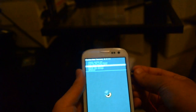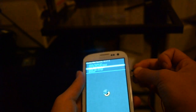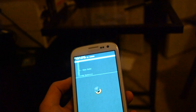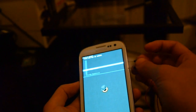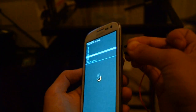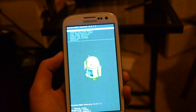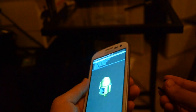So we are making our own power switch. You just keep on trying it until you get it — it'll take a bit. Move to an item you want to select, and move the wires around until they finally touch the two metal plates and make contact, registering as a power switch press. I got into this menu, selected wipe cache, and did the same thing again — put the two wires on the two sides of the power switch. Just keep moving it around until you get it. That's how you use the recovery menu — all you need is a wire to get into recovery mode and use it to select.